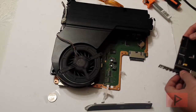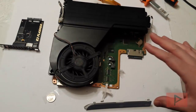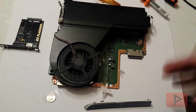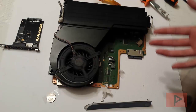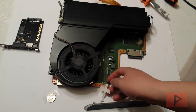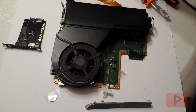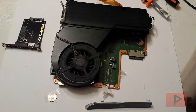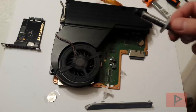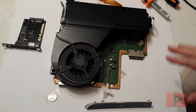Some other tips: when you're going to do your flash, make sure that you do not move anything around — otherwise you might potentially brick your PS3. My first time around I had a yellow light of death. I showed in another video how to unbrick your PS3 from that soft brick. Also, when you put everything back together, you probably want to put new thermal paste onto your CPU and GPU. Just a recap: it's Arctic Silver 5 — use a pea-sized amount on your CPU and GPU when you reapply the heatsink back onto the motherboard.